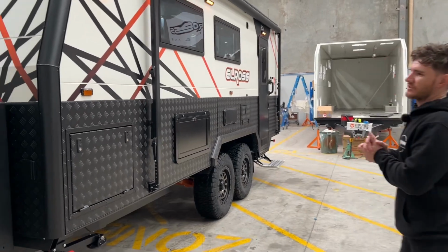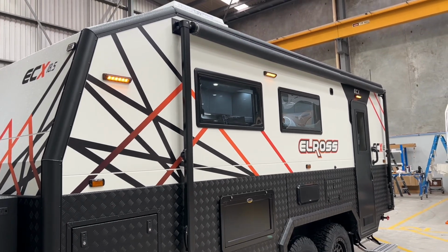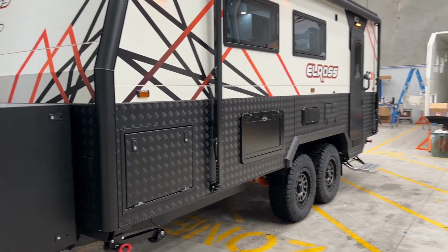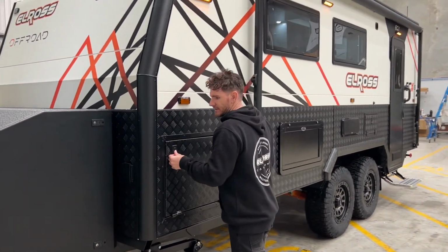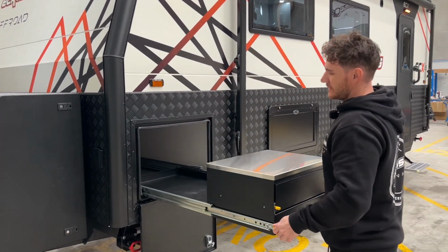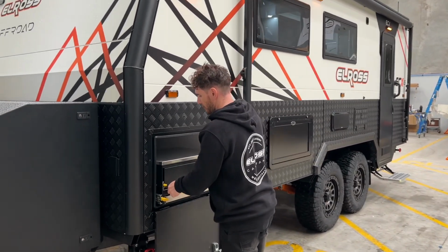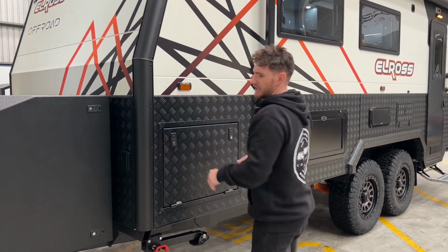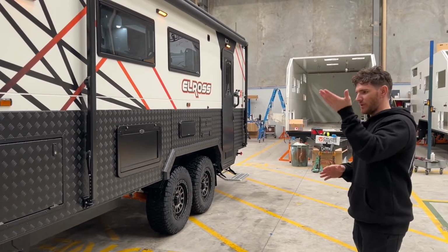Alright, so as mentioned earlier at the start of the video, ECX 18.5. Generally when customers are building an 18.5, they want to try and save a little bit of weight. Now, like I've mentioned in previous videos, things such as slide outs and big toolboxes, which we'll get into in more detail later on, all add weight. So make sure that you bear that in mind when you're deciding on what size van, because even if you do a smaller platform van, if you start to do a lot of slide outs and big options, your tare weight's always going to skyrocket.